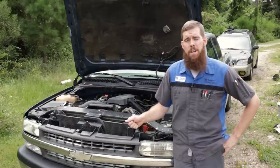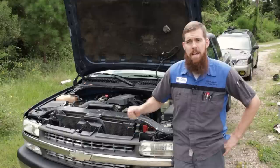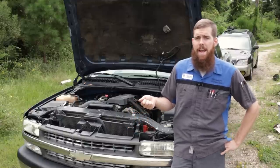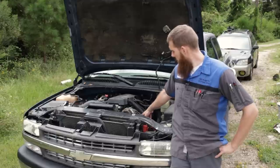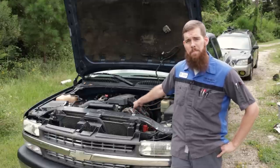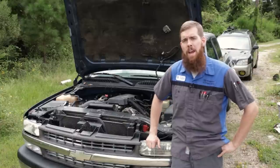Again, meter to AC voltage. Oscilloscope AC voltage graphing is a lot easier to see. Take either a rubber mallet or a hammer of any description and tap on the engine. Do so lightly. You can do so on the ground area here at the alternator bracket. That's perfectly fine. What you should see is a small AC voltage every time you rap with the hammer,